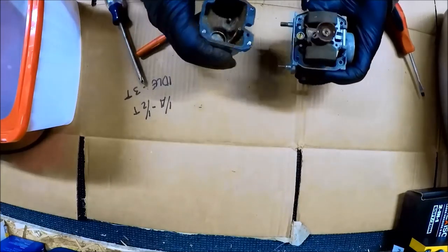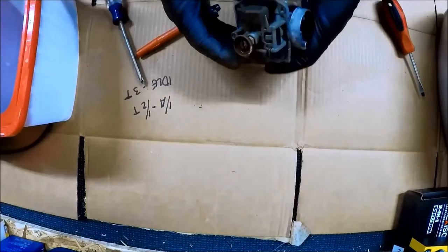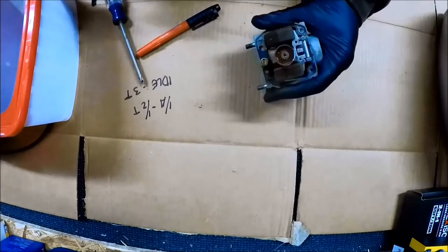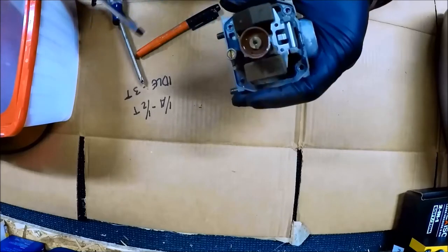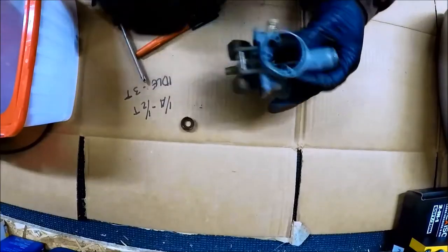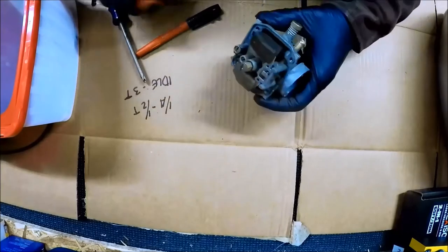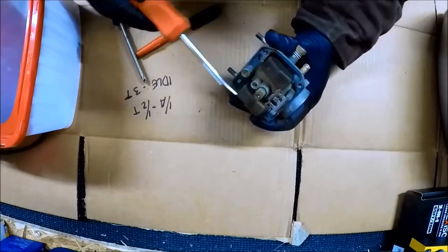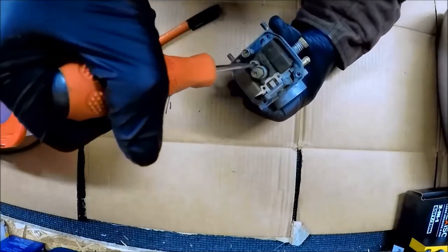It's pretty nasty in there. I'm going to run it through the ultrasonic enough to take the stink out — these old carbs can be stinky — then I'm going to take it in the house where it's warm and finish it up. Some things you can tell about the 225 carbs: around the main jet they have this baffle right here. You don't normally see that on a carburetor. I imagine it just stops some fuel from splashing around too much and focuses it into the main jet. I'll work on the slide in a second; let me see if these jets crack loose. That's your main jet — I'm going to have to check the sizes between the Moto 4 and the Tri-moto to make sure they're the same.